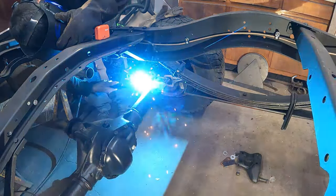Just got the plates down there. You can see how they go under the U-bolts and let the U-bolts hold down on the flat and not on the corners like they were. They were two inches wide instead of two and a quarter, so it gives a little room there. It's only going to get on a couple of threads there, so you're going to have to get some U-bolts that are about another inch longer. I'm happy with fixing that. Got the pinion angle dialed in — it's within half to three-quarters of a degree and barely moves around, so it's way more than good enough when the truck gets loaded or unloaded. It was six and a half degrees off, now it's within less than half a degree. I got my tie rod back in, adjusted, painted that too, and set it to about a sixteenth toe in.